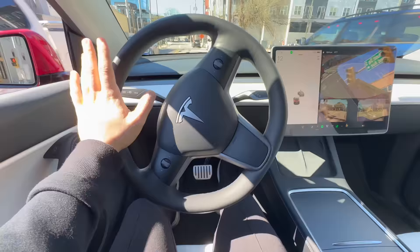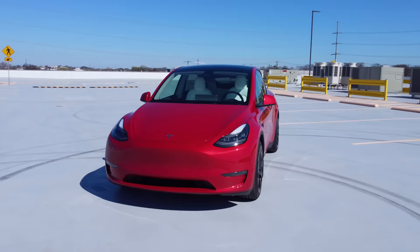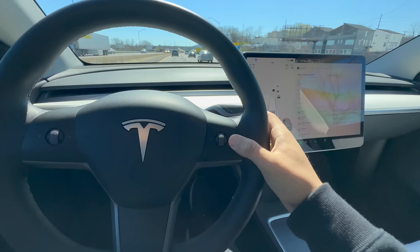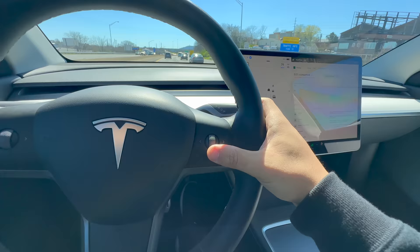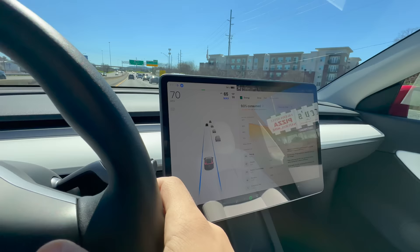While you're on autopilot, it can get tedious to scroll one by one to get the right speed you want, or if you quickly need to increase or decrease your speed. Rolling the scroll wheel changes the set speed in 1 mph increments. But here's the hidden trick: roll the right scroll wheel up quickly to increase or down quickly to decrease the set speed. Quickly rolling the scroll wheel changes the set speed in the closest 5 mph increments, making it easier and safer so you don't have to constantly peek at the screen to see what exact speed you're at.